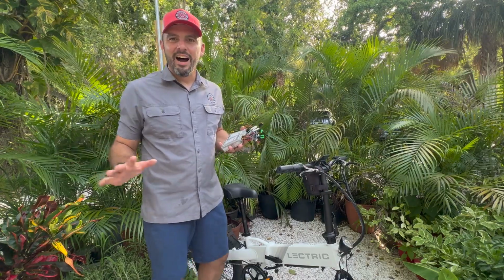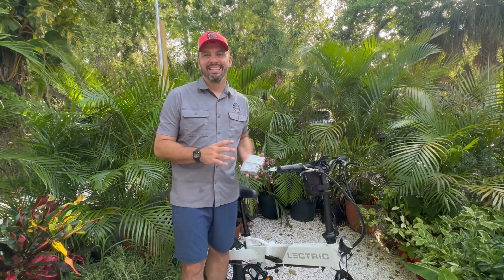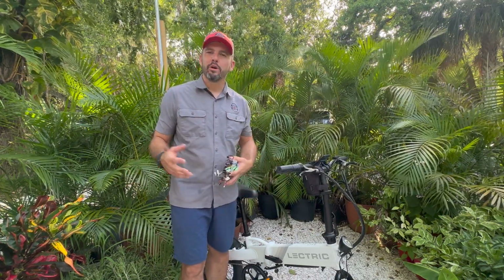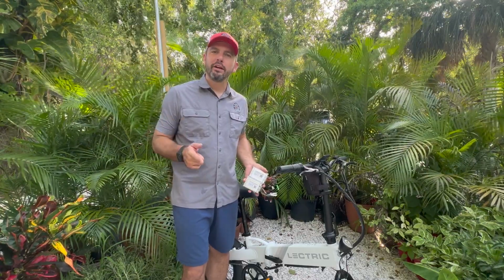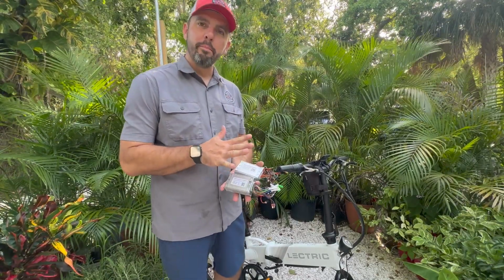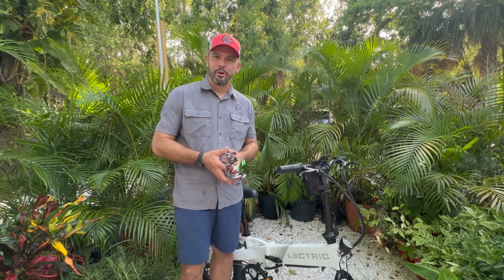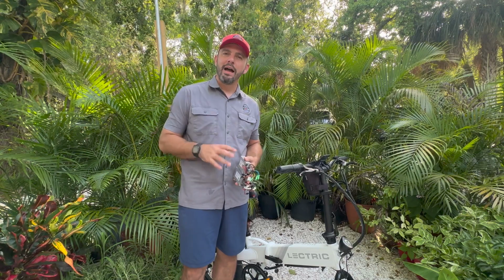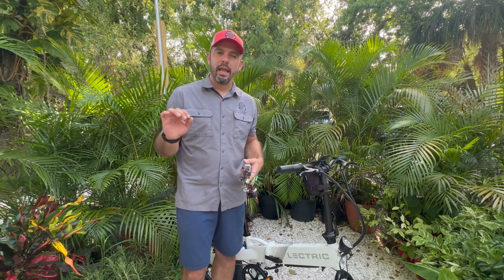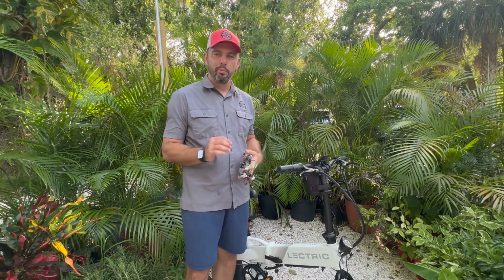Alas, we did not find success with the sample controller when it comes to the XP Lite. Kind of anticipated, would have hoped for something different, but there's a couple variables here. The model for the M5 display is different. The controller for the bike itself is different from the XP2.0. And of course, the motor is different at 350 watts versus the 500 watt rear hub. We also suspect there is some limiting capacity within the motor, as well as sensor signal read differentiation between the motor and controller for this one versus the XP 2.0.